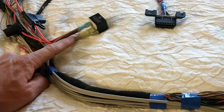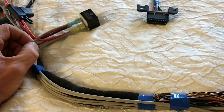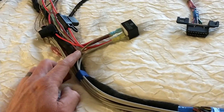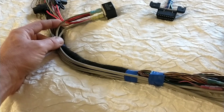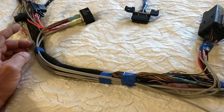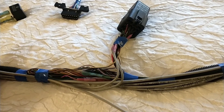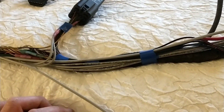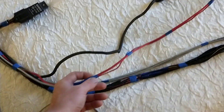That covers all the grounds and powers, putting it down to two power wires: the main feed on a 30-amp fuse, and your key-on wire. The big thing with the key-on wire is it has to have power while cranking and while the key is on. It's best if you can find whatever is feeding the ECU on the swap vehicle, because that gives you full-time power whether you're cranking or not. Test it with a meter — key to ON for power, then key to START to make sure you still have power, because losing power while cranking means no fuel and it won't start.